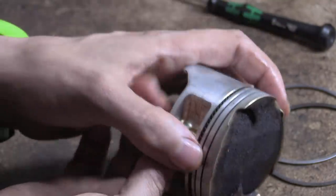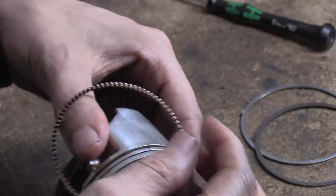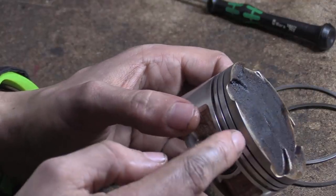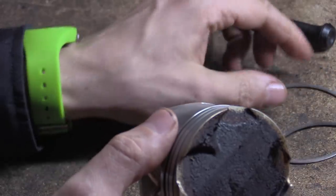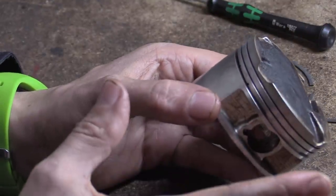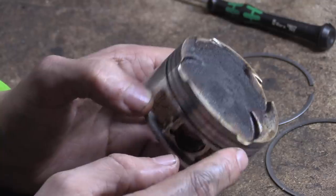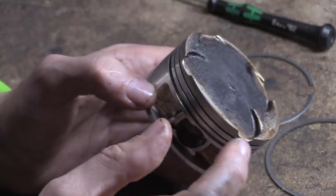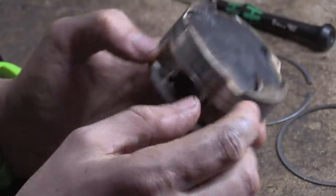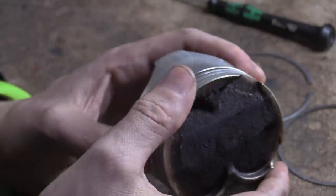Give it a quick push and a turn and you'll snag the end — or if you squeeze the ring together it usually pops. These spacers are flimsy things that basically hold and retain oil between the oil control rings. Job done. Your top and bottom rings — the second compression ring feels a bit thinner. These rings are junk so I won't put them back in. I'm going to get some new rings and use the shadowgraph to compare one ring to the other so we can actually see the wear — ring end gaps and thickness differences.